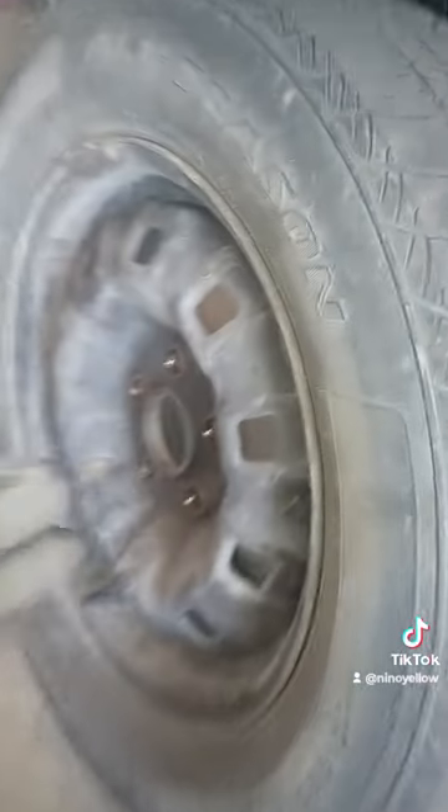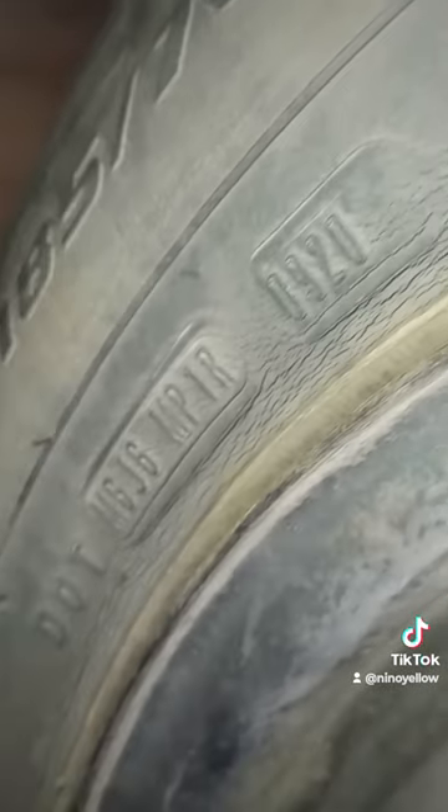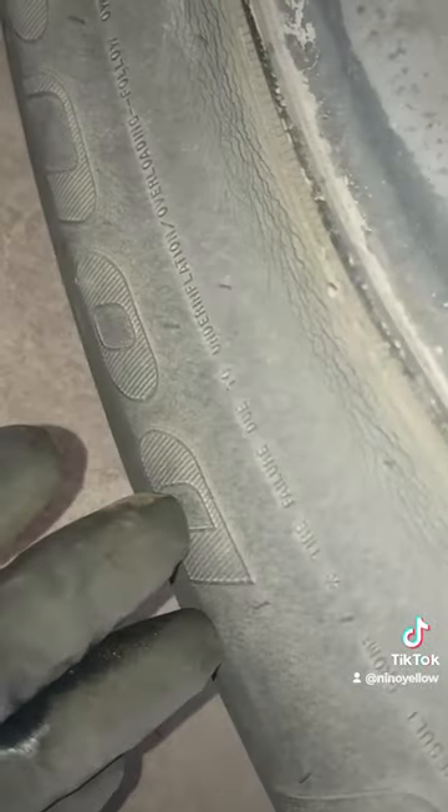All of this is going back together, but I want to make a note that this is how my channel goes - I do a whole lot of work and basically accomplish nothing. Before I put the tires back on, I want you to see how unbelievably weather-cracked these tires are. They were made in the ninth week of 2020 - only three-year-old tires, the cheapest ones from Walmart. They've weather-cracked so badly they've created a very slow leak. I've gone over the tire with soap and water and can't find a specific leak point.